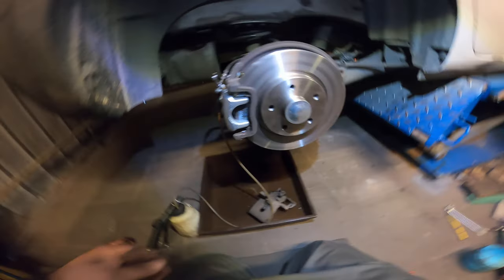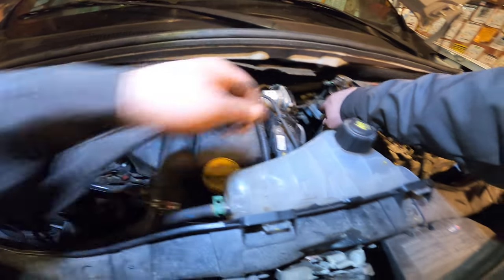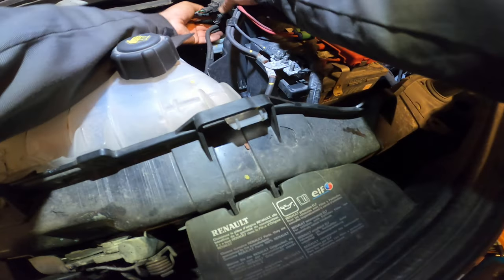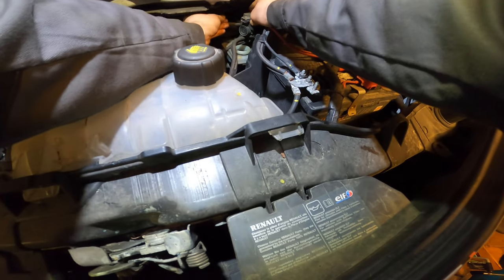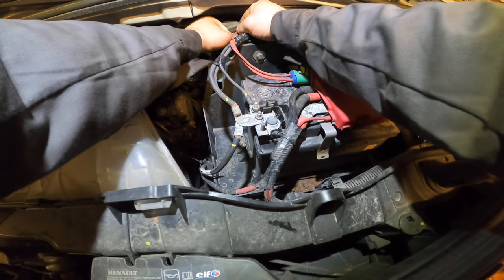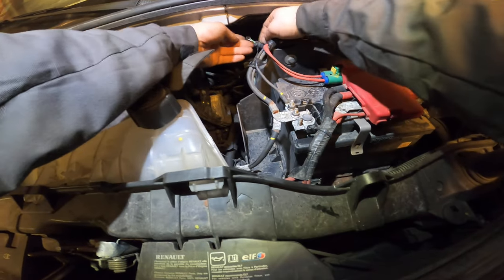Put your thing on there. And let's open the hood. Make sure the brake fluid is topped up. It's sitting right over there. It's looking brown. I'm just gonna release this connector and take this sensor off, and suck out the brown fluid. Alrighty.